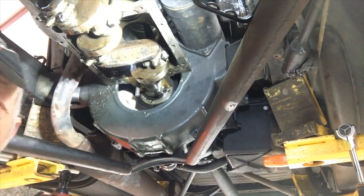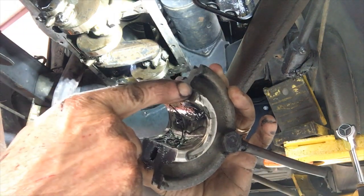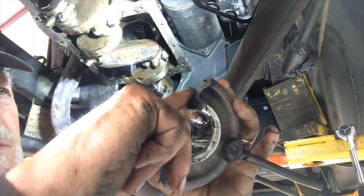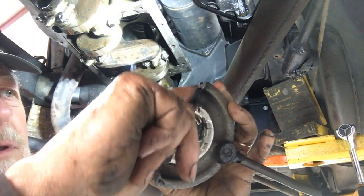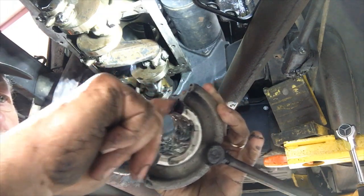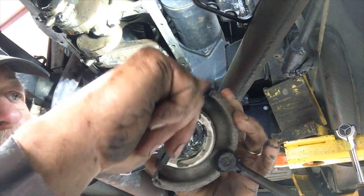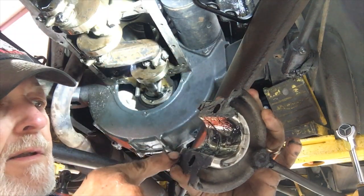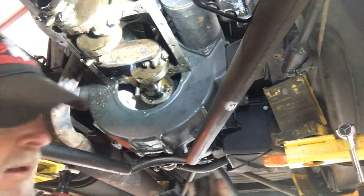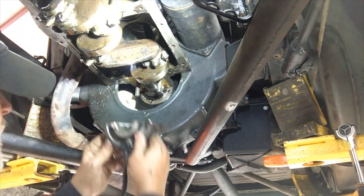Okay, we're back now and we've put a little bit of silicone RTV right around the edge here. You don't want to put much because you don't want it to get in any oil passage and stop it up — just a little bit of sealer, a little dab. I've added the shim back and re-torqued the cap, so we're ready to put this back on and button this one up.